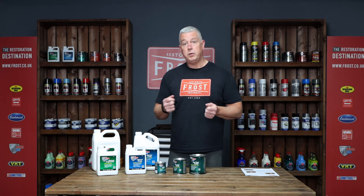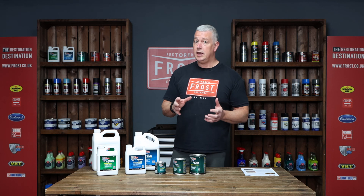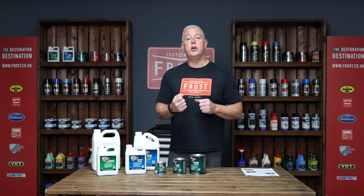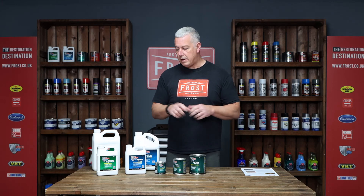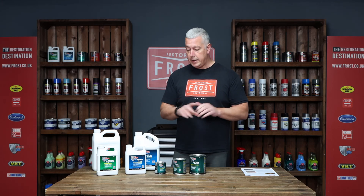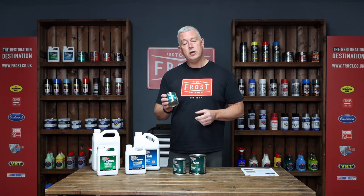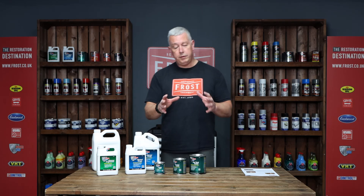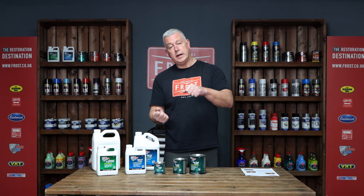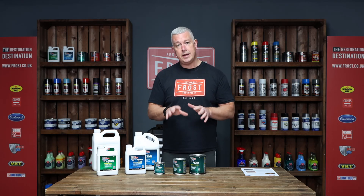The best way to dry it is normally with a hair dryer. If you're going to use a heat gun, be careful as it can create quite a bit of heat. Cold air literally just blows moisture around — you must use hot air to get it dry. When the tank is nice and dry, take the lid off the tank sealer, don't shake the tin, give the contents a good stir, and pour it into the tank. Just keep turning the tank until you get a nice even coating on the inside.